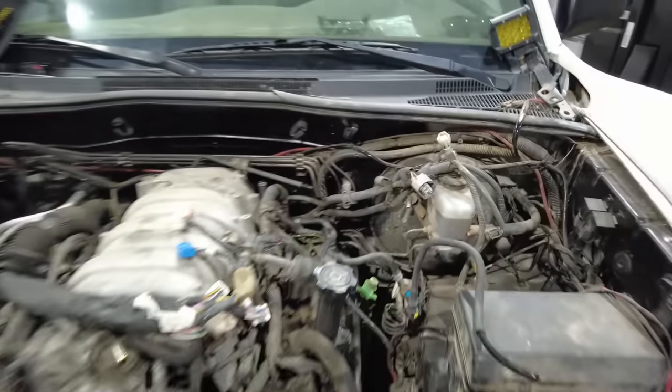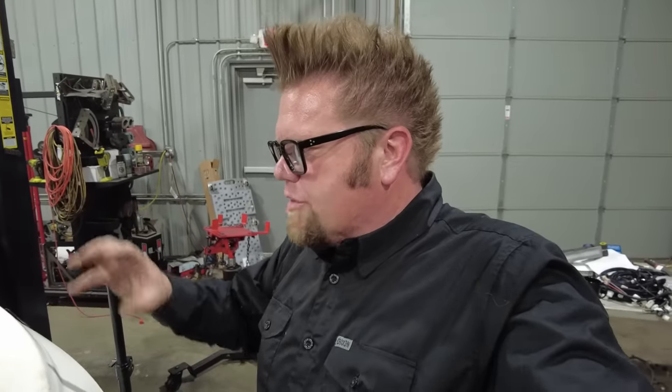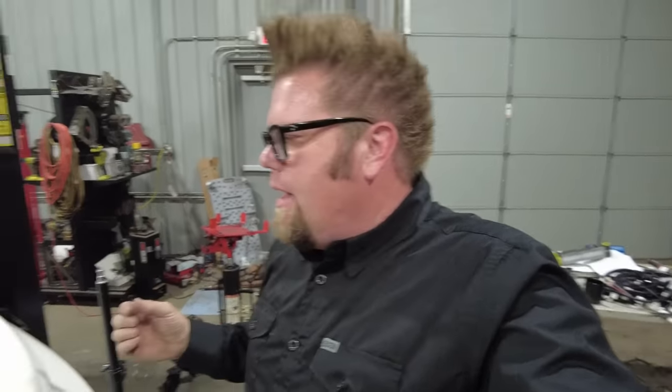So right now, I'm going to try the way this hose works: you have to kind of heat it up. There is a special tool you can use, but you can just give it a little bit of heat and it usually will become slightly pliable. I think I'll be able to slide it over that barbed fitting, and then when it cools down, it'll basically seal up.